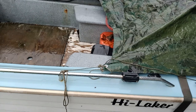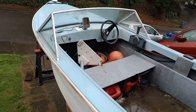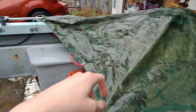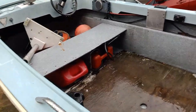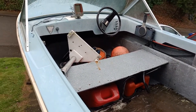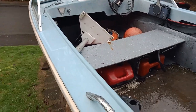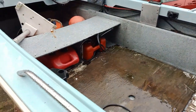As far as the survey, the first order of business I'm going to fix is the side deck. Then we're going to fix the transom. Why we're not doing the transom first is because I don't have a huge amount of fiberglass experience — I know a fair amount about fiberglassing but haven't had much practice. So I'm going to first practice on a couple pieces of wood joining them, then practice reinforcing under the side deck, then work on the transom.